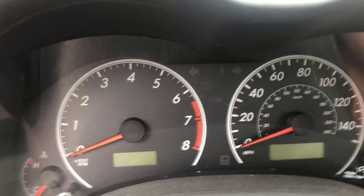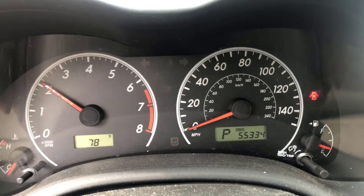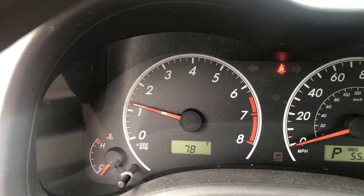The lights are not blinking anymore because I got the paper clip removed — and there you go, car starts. All the lights are off, and it will program the idle automatically. So let it run for about two minutes and it will program the idle.